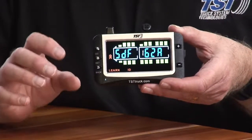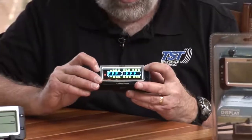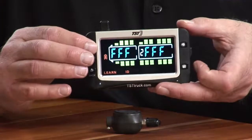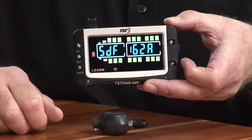Keep that in mind — make sure that you have number one on the trailer as you're programming every tire. Instead of hitting go, you're going to be hitting the plus button to go through the different tires and tire positions, then programming. Be careful of hitting that go button. You only hit the go button after you hit set and see all the Fs blinking — then you hit go and it'll grab that code, hit set, and you're good to go. Notice that number one is still on the screen, and that's what you want. If you only have one trailer, make sure you put all the tires on the same trailer slot and don't hit the go button, because if you do, you'll be shifting from trailer to trailer instead of staying on the number one position. That's just some good advice when you're trying to code this.